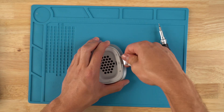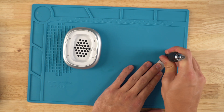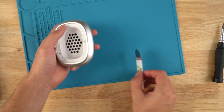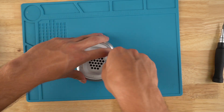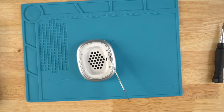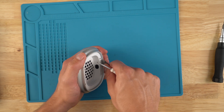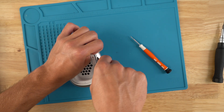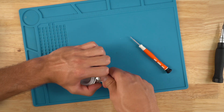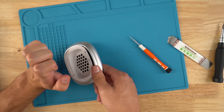Okay, you can see this pry tool is bent, so I'm just going to flatten it out to make it more stiff. Now that it's a little straighter, I'm going to give this another try. I'll grab a flathead since that would be the next most available tool for most people — I'm going to use it as extra leverage. I'm also going to use my fingers here. Once I have enough room for my four fingers, I'll just pry like this.